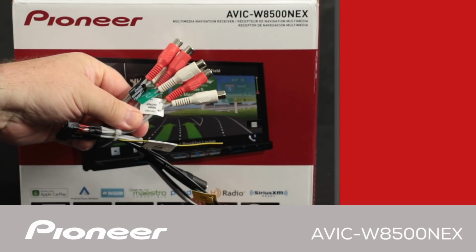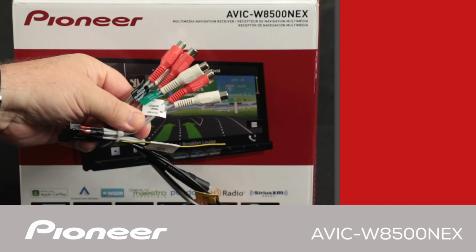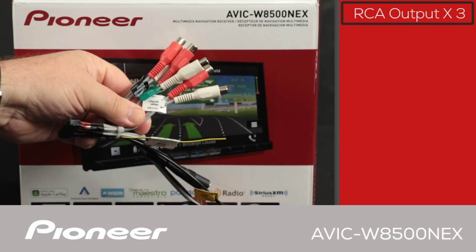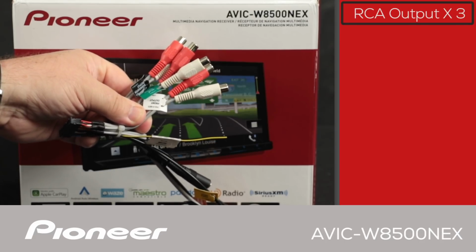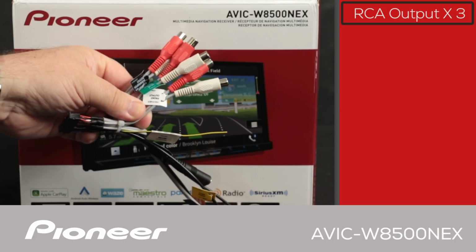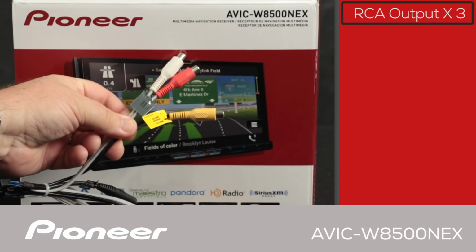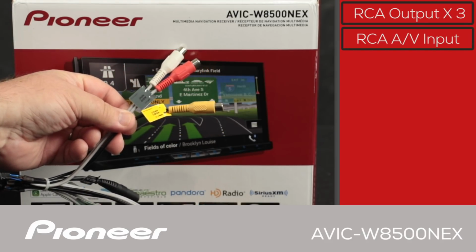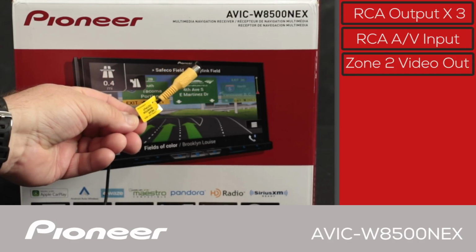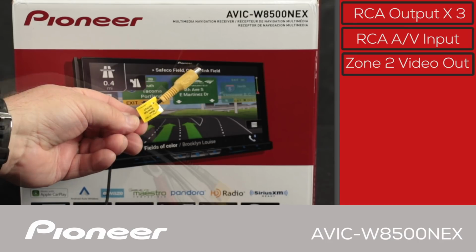On the signal input-output wire harness, we start off with 3 sets of 4-volt RCA outputs for operating external amplifiers. They can be set up as front, rear, and subwoofer output, or for higher audio quality and better system control, high, mid, and low output. Next, we have an audio and video RCA input. This can also be used as a second camera input. Here is the rear monitor or second zone video output.